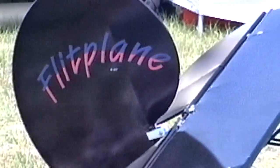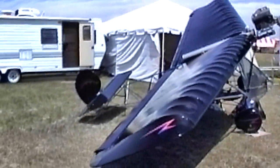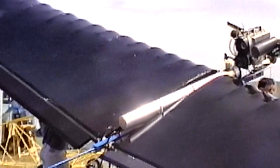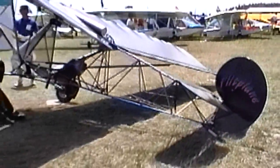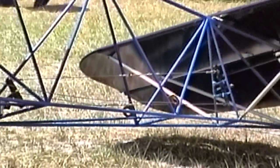What type of engine are we powering it with? We're using the 2SI, which is — this particular one is a 460F35, it's a 35 horsepower engine, single carb, single ignition, electronic ignition. We've had very good luck with it. Guys are saying they've got 800 hours on them and they're tickled pink. We got one guy that says he's got 1,400 hours on his and he's just changed out the tops — the rings, spark plugs, and pistons. We feel we have a really solid engine here and it keeps us at 247 pounds, which is below the 254-pound weight limit.